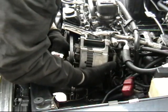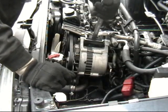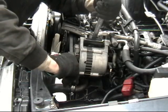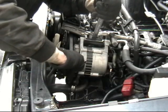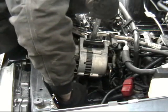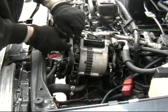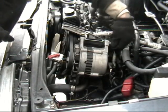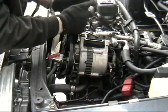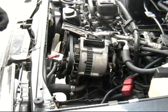I'm going to draw the alternator up and take the slack — usually I'll take a small wrench or whatever, try it in there, give a little lift up on the alternator — and then I will tighten down the bolt on the bottom side of it. Once I have that in place, I take that out and go ahead and tighten up the top bolt. The top bolt has a nice captive piece here so you don't have to hold it still. All you've got to do is make sure it's on there when you put your bolt through. We never did remove the alternator from this — we just swung it out of the way the whole time we had this apart.